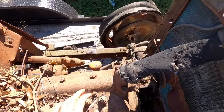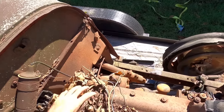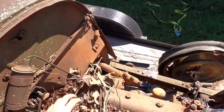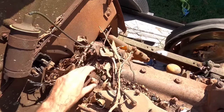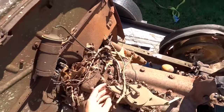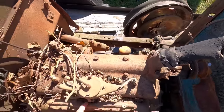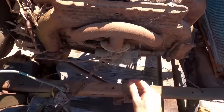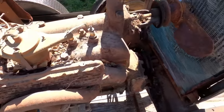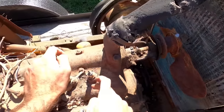Someone's broke a spark plug wire — well, you'd call them wires, but they ain't really much in the way of wires. We'll break some of these leaves off here and see what we're working with. There's that one — we're missing this one, but we'll fix that with just a piece of wire. Little updraft carburetor; the fuel lines have since rusted off of it. We are engaged in the crank, which is a good sign. Good old Champions.